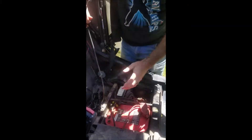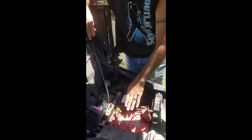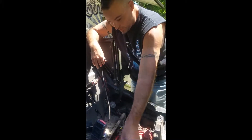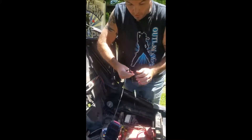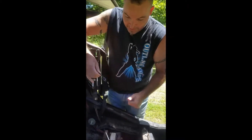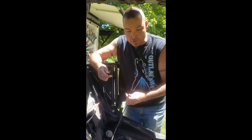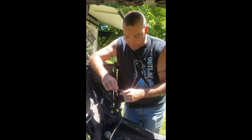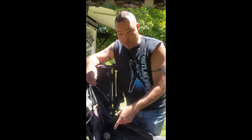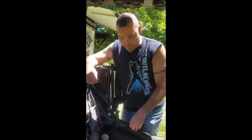For time purposes we've already installed our power cable onto our battery — red goes to positive, black goes to negative of course. From there is going to be our controller brain, which is real easy to plug in. If you're not using a toggle switch, try to get it to where this is easily accessible so that you can unplug the controller brain. If you do leave the controller brain plugged in and just use the remote, then you will have some trickle draw off of the battery.